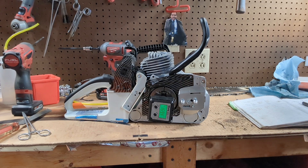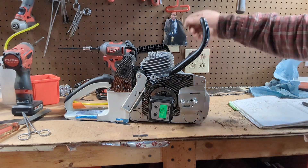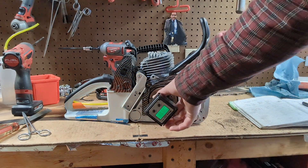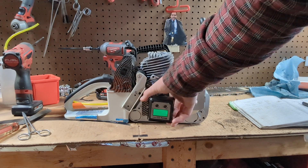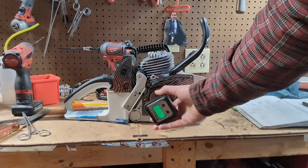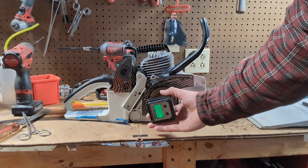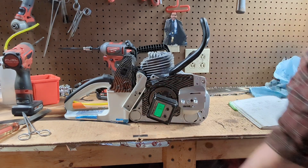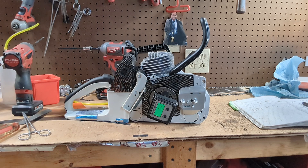So now we know our intake and our exhaust durations. One thing you can do if you want to just cheat a little bit — go all the way back to zero. See how the number's going back down: 50, 40, 30, 20. All right, zero essentially. That's right where we were when we zeroed it out last, which was when the exhaust port opened on the downward stroke.